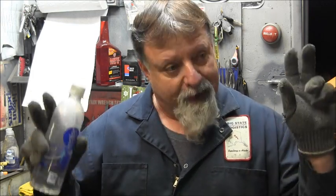You wonder if I'm raising that motor and the voltage is coming up to 16 volts or even more, wouldn't that overcharge a battery? Well, without going into the bilges on this thing, the word rectifier, or rectify, means correct. And it's my understanding from reading and researching, what happens is, if you've got a 400 or 500 cranking amp, 12 volt battery, and it's a little bit low, the rectifier will send the charge down the terminals. Well, the whole system will. It will send it to the battery, and it has a way of correcting over voltage, in theory.